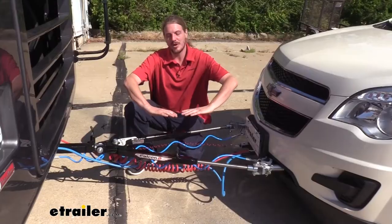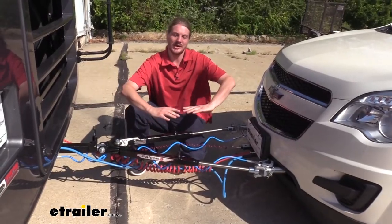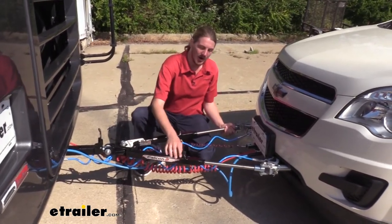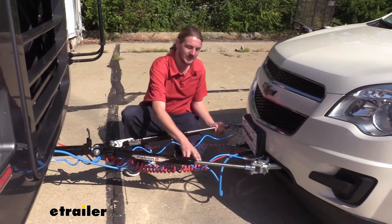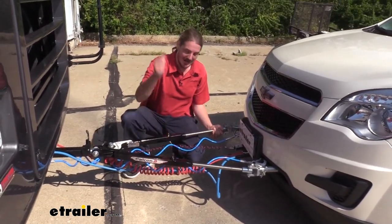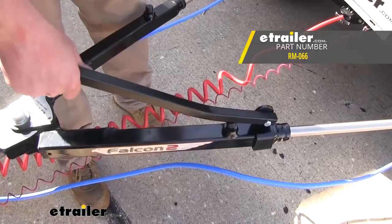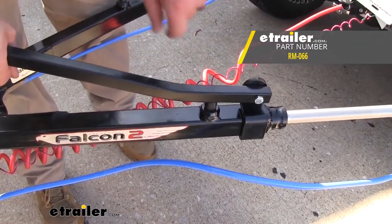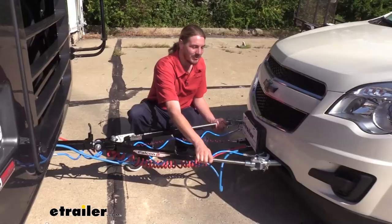If you've got your vehicle parked at an angle and your motorhome at another angle when you're at your campsite, it can be very difficult to get the arms disconnected. With this style tow bar, you'd have to press in on these little buttons to get it to release. And when it's in a bind, you'd almost have to bust out a hammer and slam on it to release it. There are levers available at eTrailer.com that you can purchase to get additional leverage to press down and pop these loose.